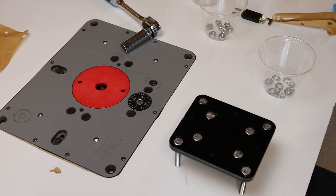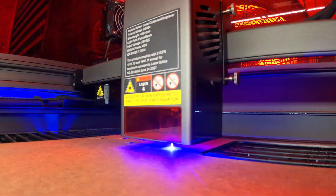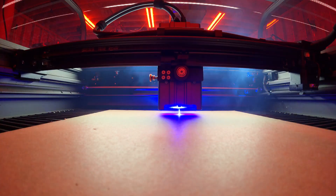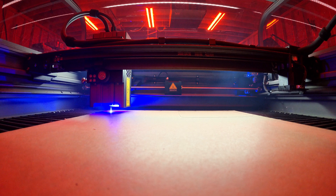It's probably a good idea to put some kind of cover on the top. That cover needs to be clear so you can actually see the fuses. And that is a big problem because this laser can't cut clear acrylic. This is a diode laser — sometimes called a blue light laser because it emits a blue light. That particular wavelength of light will pass right through clear material and blue material. That is the main drawback of these affordable desktop lasers. To get a laser that will cut clear acrylic, you've got to kick it up a notch and get a CO2 laser.